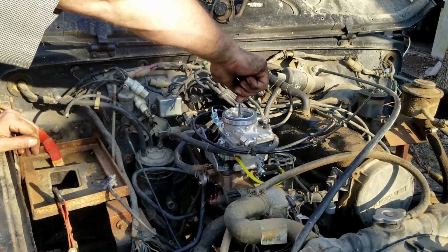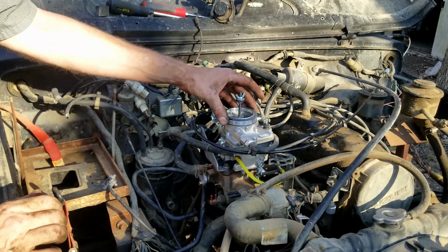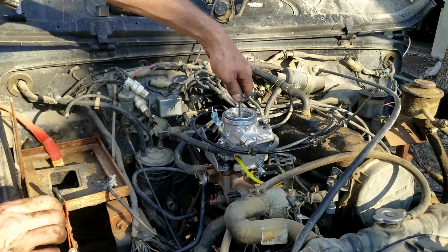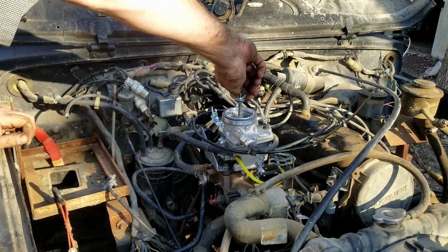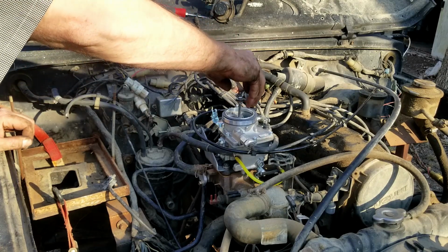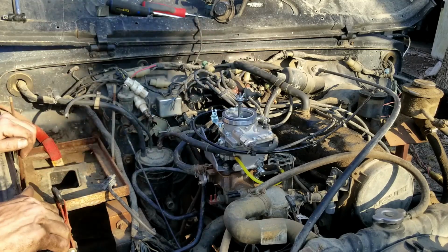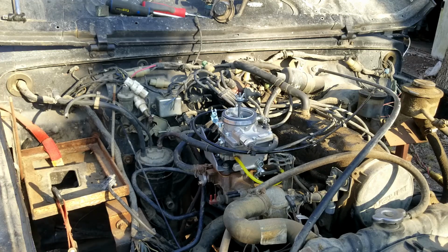A large ring gasket goes on first onto the carb, followed by the aluminum ring, then another large ring gasket. The stud nut assembly is installed into the carb and threaded in as far as it will go. A washer gasket is placed onto the stud with the gasket surface facing up. With the items installed, place the stock hat onto the carb. The washer gasket should just touch the inside surface of the hat. If the washer gasket holds the hat up from sealing onto the aluminum ring, simply thread the nut down the stud until the hat can seal.